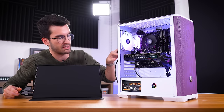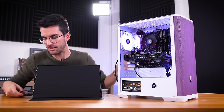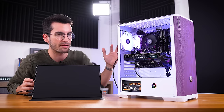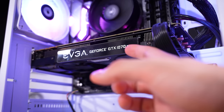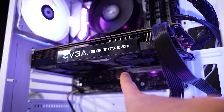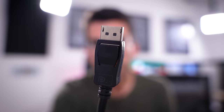The only other thing I can think of is — it's possible the card has a bad HDMI port. Not common, but it has happened, so it's worth swapping to DisplayPort to rule it out. It's really strange because we get LEDs at the front, meaning the card is getting some power, and the fans occasionally spool up and then stop. DisplayPort was not the issue. Also tested the 1070 Ti on a separate makeshift AMD rig, and still no signal to a monitor. So we really have no choice — we have to replace the graphics card.